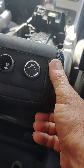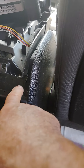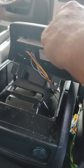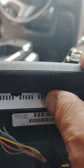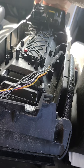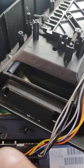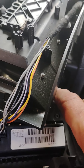I thought this was going to be a real bear, but it's actually not that bad at all. First and foremost, there are two screws underneath. You can see the tabs right here — one here, one here — and they actually sit below. You have to slide the center console armrest back like so in order to get to them. Then you can see the holes here and here.